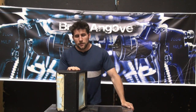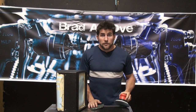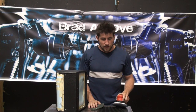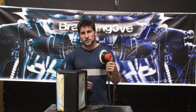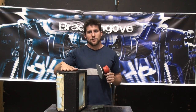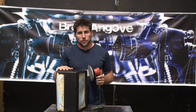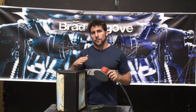As with almost any paint job, the first thing we need to do is scuff this stuff up so that paint, or primer in this case, will stick to it. I'm going to try and get it just a little flatter as I do that. I've got a couple of implements I'll be using to sand this. First of all, I have a DA sander — this one's pneumatic. DA means dual action, by the way. It has more than one spin pattern so that it doesn't leave swirl marks in your project. I'm using this with 400 grit paper.